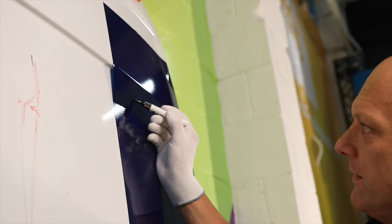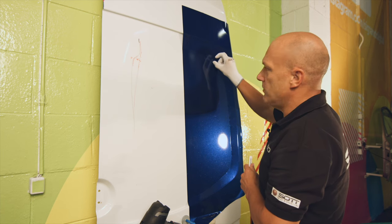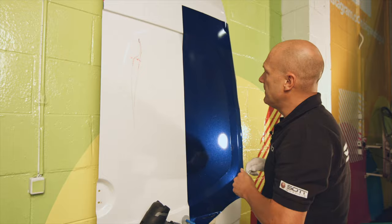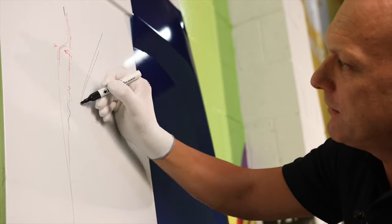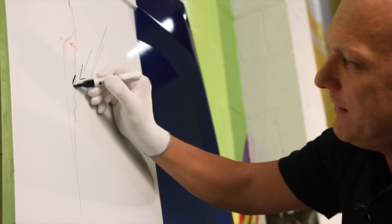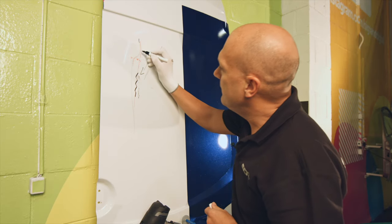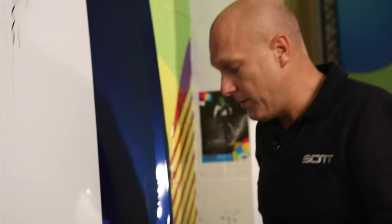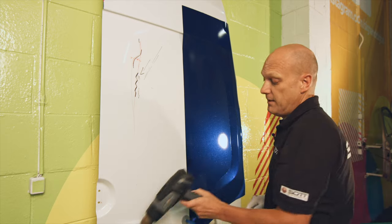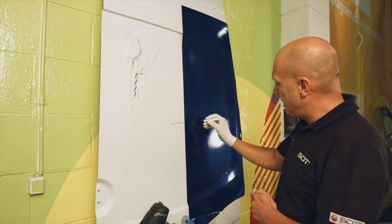If we stretch it here, this part will stretch only and this one stays in place. I leave the channel cold but I make it hot over here on the flat surface — my heat gun goes like this to heat up this area. So this one will stretch outward — the whole vinyl is relaxed in the channel area. We tried that with polymeric calendar film and it still stays. You can't officially claim that because you won't get any warranty from the factory, but it works.